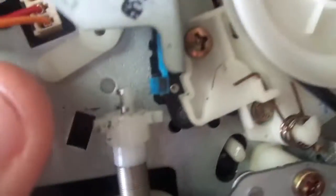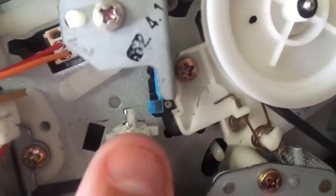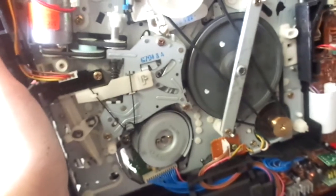You guys might think this VCR looks really complicated to fix the belts on — not really. Here's what you have to do: carefully unscrew the motor assembly — it's held by one screw — then carefully pull the motor out. Then you'll get access to this area of the belt. It's not attached to the worm gear so you don't need to worry about that. Then you're ready to replace. Slide the belts in down there like this — and that's how you replace them. It looks hard but it's pretty simple.